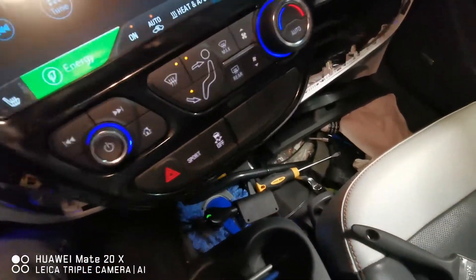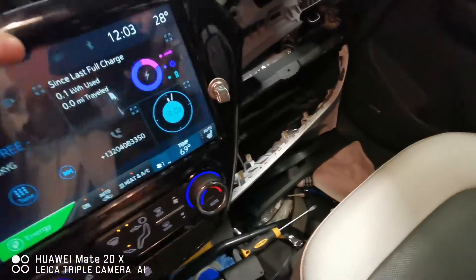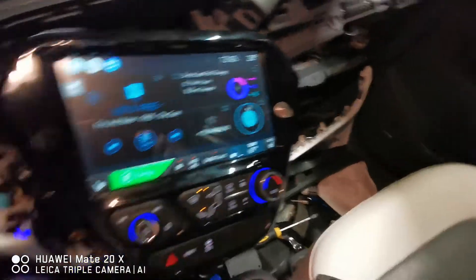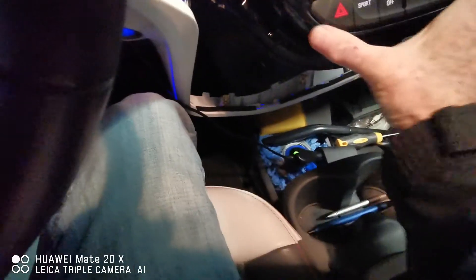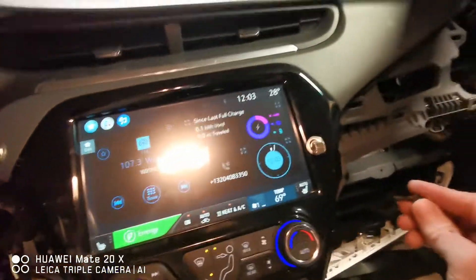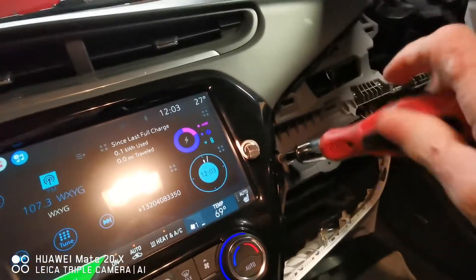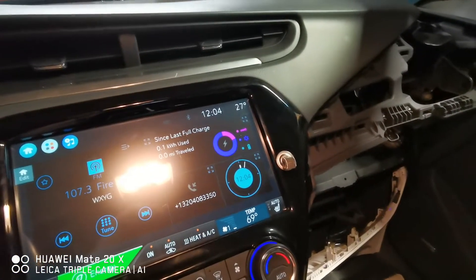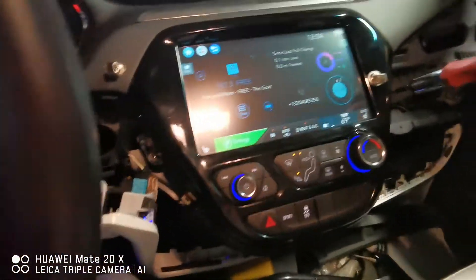Quite the photographer here — I can't do that one-handed. There we go. All you have to do is find your screws. They're seven millimeter bolts, and that's all you need. That's all there is holding it, which is pretty cool — one of a thousand reasons you don't have to take the whole dash off.